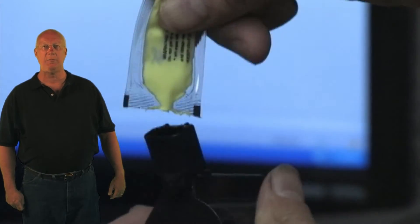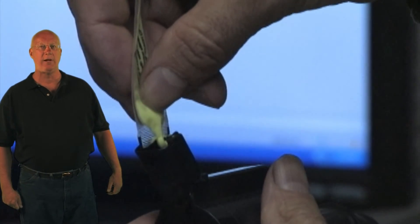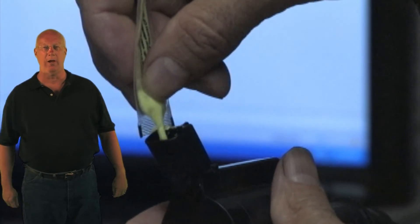In addition, a grease packet and instructions are included in each box. Apply this grease at the bottom of the boot, on the spring, and at the connection at the top of the coil-on plug.